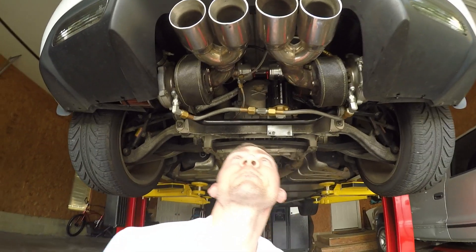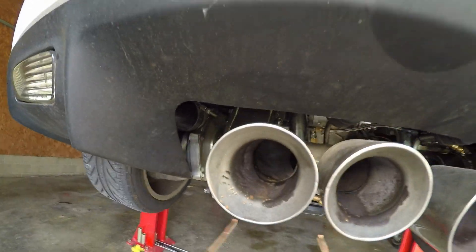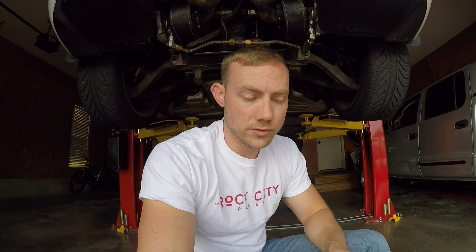I've finally figured out how to stop the oil from coming out of the turbos in my rear mount kit. I've been driving it around for two, three weeks now and no oil in the exhaust. What I've noticed is that if you let the turbos sit for a little while on a humid day they get a little bit of rust inside the exhaust — that's what that brown stuff is. It's just rust and water from whenever you first started up.